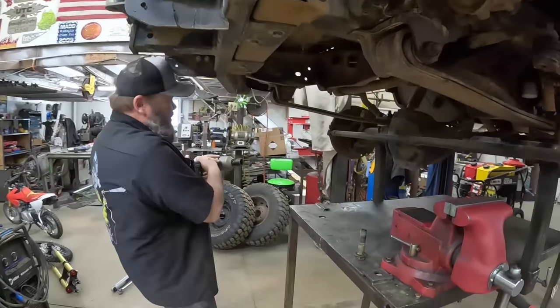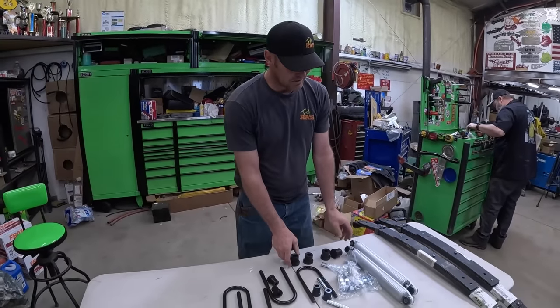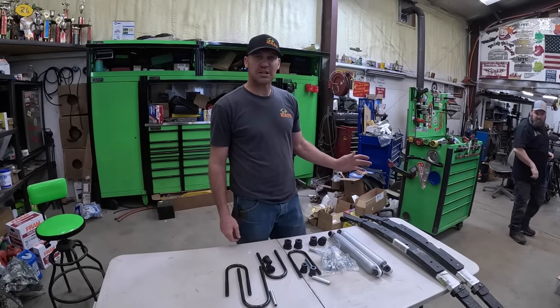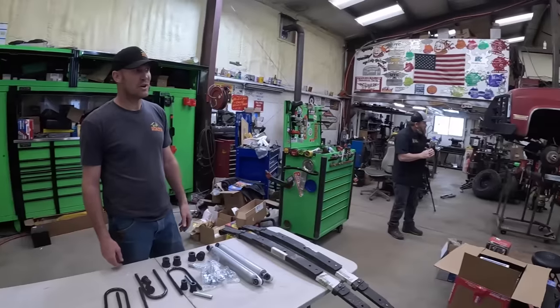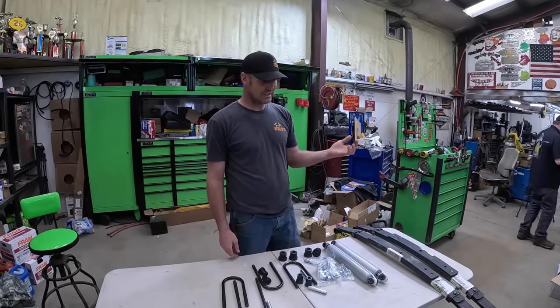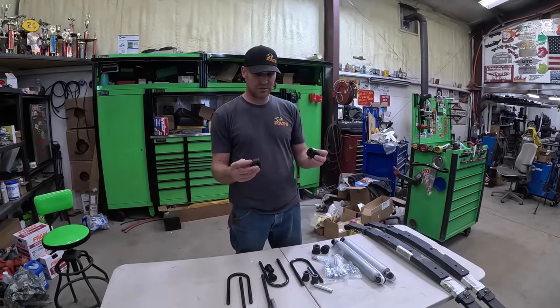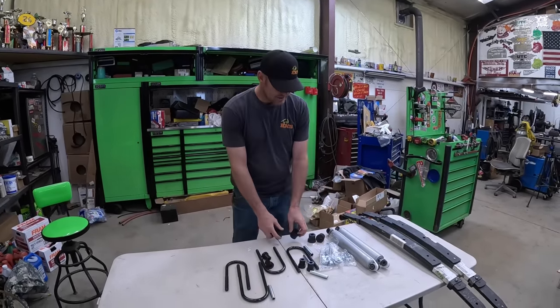There's a small bolt removed. The lift kit we're putting on today is a Rough Country — they're not a sponsor or anything, basically it's the cheapest lift kit I could buy. We're putting it on, going to test it out. It's on the red truck — look at it, it's falling apart, rust everywhere. I don't want to spend a pile of money on this truck, I just need it good enough to beat Hunter. I'm going to put a little grease on the bushings, slip them in, grease the centers, and get them all ready.